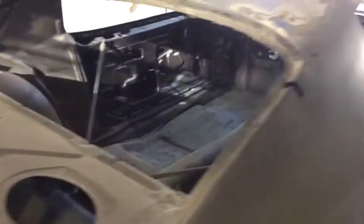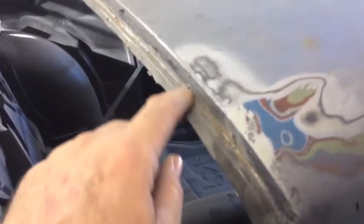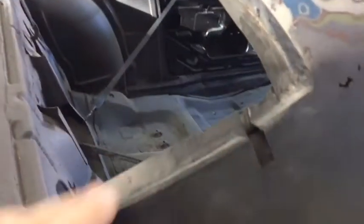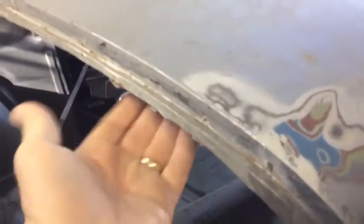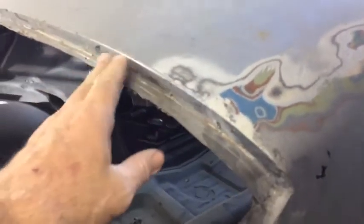More work to do on the spoiler before we mount it. And when we get the roof skin cut off, we're going to have work to do on this back lip from the inside panel. All this has been what it looks like is scabbed on with old galvanized, like way back around the other side of that windshield when we took all that mess off and rebuilt it and this side. So we're definitely going to have issues there, but we're going to try to let the roof skin dictate. We'll build this out and then when we place our roof skin on the parts that we know are good, we're going to try to just cut back to the roof skin line and let it dictate where that inner panel ends up so that it'll be just as smooth.